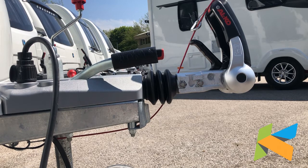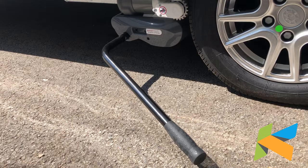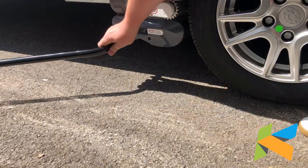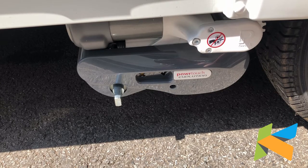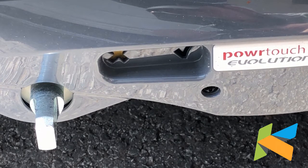We're back at the front of the caravan and we're going to put the handbrake on before we disengage the motor mover so it doesn't roll. We're back down by the motor mover at the wheels and we're going to disengage it. We put the bar back on as we did before and make sure it's locked in properly. You must use two hands to disengage the motor mover — the spring is very, very strong and you can do yourself some damage if you don't do it properly. One hand here, one hand here, control it over and then off. We must make sure the last thing we do is double check that we've got a yellow icon on the cross so we know that the motor mover is disengaged.